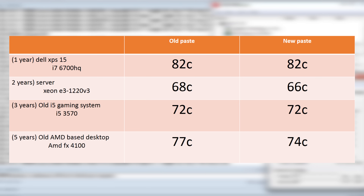Here are our new numbers. For the one, two, and three-year-old systems, they didn't really see much of a performance increase. However, when we get to our five-year-old system, there is a slightly larger difference between the old thermal compound and the fresh stuff. But at the end of the day, the performance difference even at five years is really very minor in this particular case. Do keep in mind that some thermal pastes and some installs will vary depending on the system, and it also depends on how you originally applied the paste.